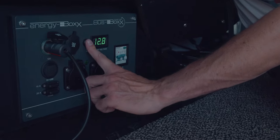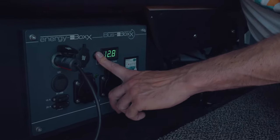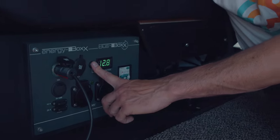It will go down while using energy. Till 12 volts is very good, but if you go to 11 volts — when you are getting below 11, it is empty — you should drive a bit to get the battery recharged, or use solar, or use a camping site.